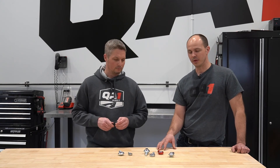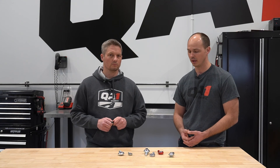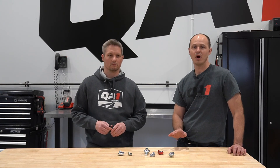It's also good to remember that rod ends are a wear item and they are going to have to be replaced at some point. The life cycle of a rod end depends on how it's being used, how much load it sees, and the conditions — whether it's dirty, sandy, or in a corrosive environment. If you're using rod ends on your race car, make sure you inspect them on a regular basis. When they start to loosen up and get play in them, you're going to want to replace them. Thanks for watching, check us out at QA1.net and go drive it.